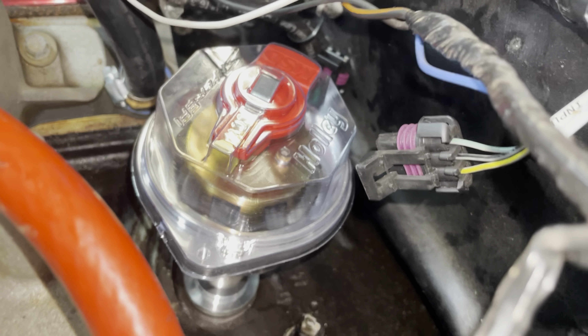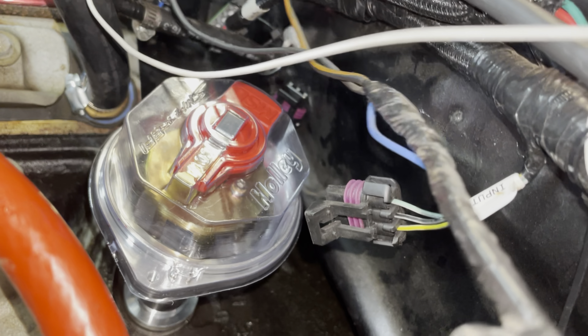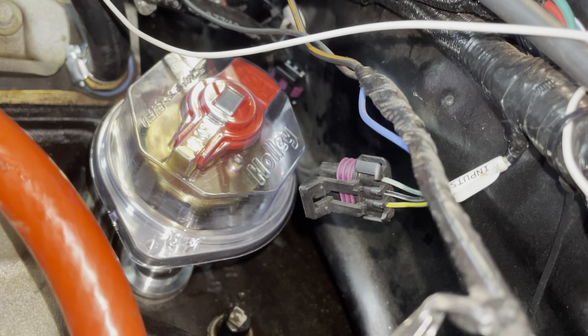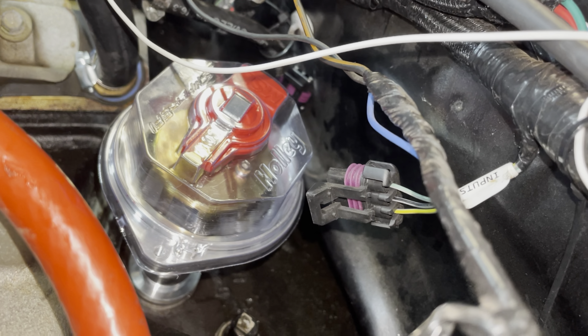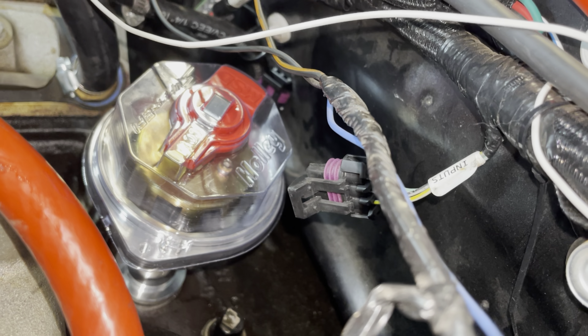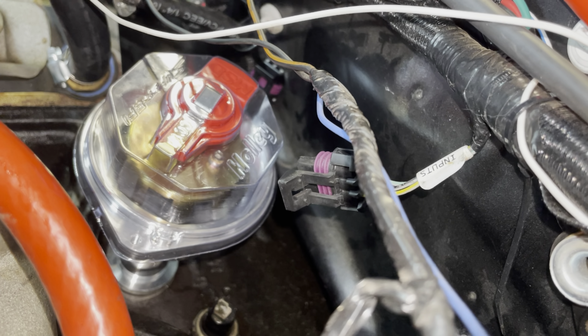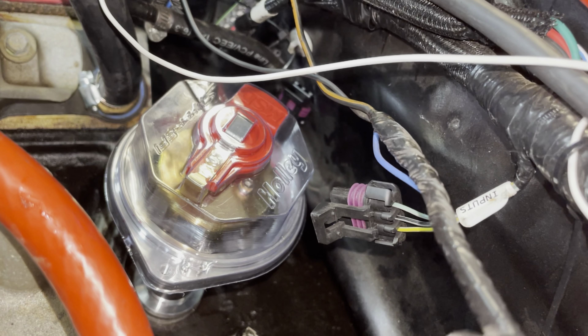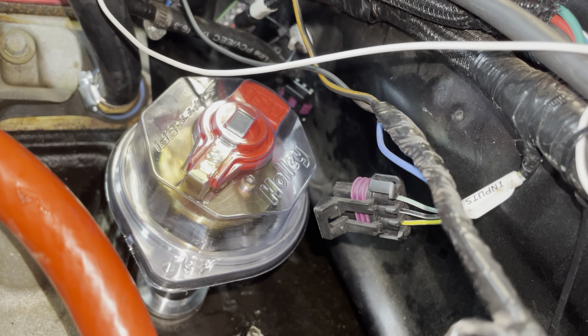We've got our new distributor in here with the bronze gear on. I might order another one — the gear on that old Excel distributor is pretty worn. That is something you've got to worry about with brass or bronze distributor gears: they're only good for about 10,000 miles, so you do have to check them periodically. This is the little phasing cap — Holley makes some really cool videos that make this process really easy to see. You stab the distributor in, get it roughly where you want, then use this little cap to phase the distributor. There's a little notch right above my finger, and we've marked the body in red — that'll be where the number one spark plug wire goes on the cap. Now we'll leave that cap on so it doesn't move and bolt the distributor down. That's fully installed.